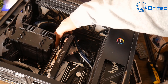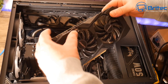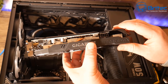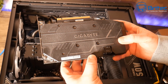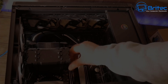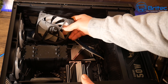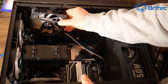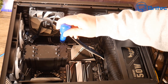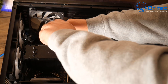The fans need a good deep clean, but I'm not going to spend my time doing this. I've got a case with some fans already in it. This one just needs a light blowout and a rub down with some alcohol to clean it up, then everything can be reused. I've got the graphics card out and I'm just going to remove the fan off the CPU cooler here — I'll just leave it there for now until I remove the actual cooler. I just need to get access to the screws on the other side to remove it from the PC.